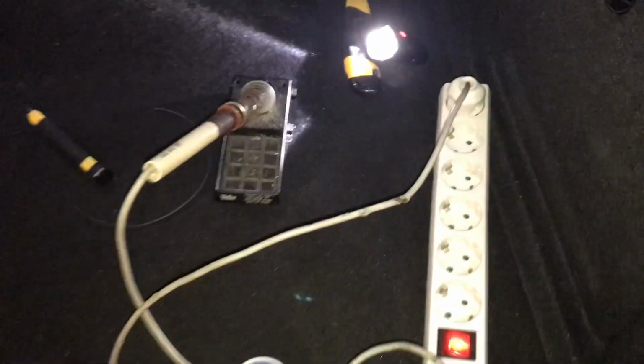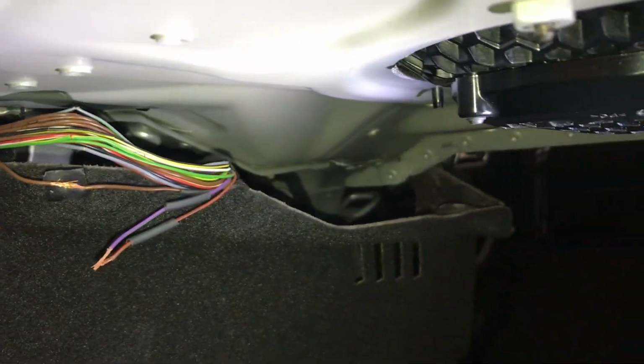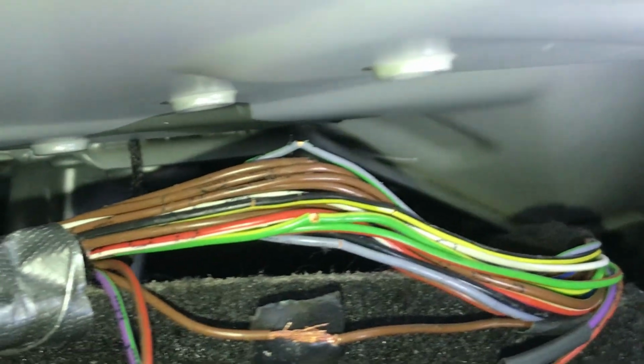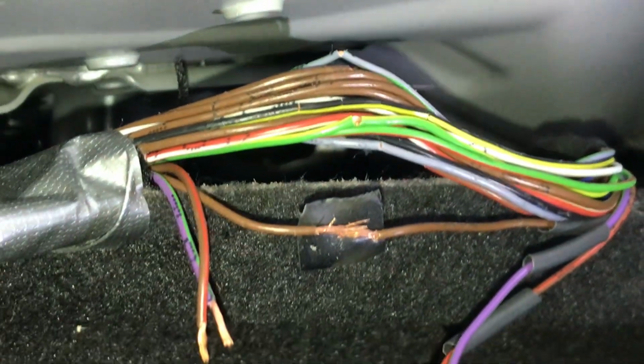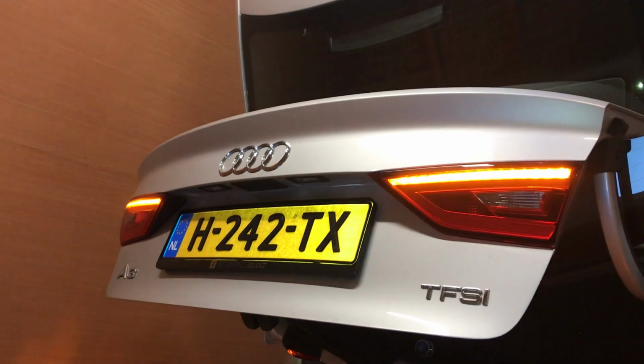Of the hazards again. And right here you can see my soldering equipment, and I tore the cable apart, took off the tape that was secured around the cables, and you can see I just didn't do anything. I just removed the tape, and those 3 cables at the bottom just came apart. So now we have to solder those back together, and once you've done that, insulate them with some tape, make them extra strong, lots of tape, so that part at least doesn't move that much.